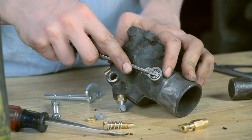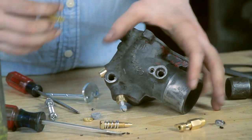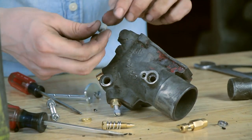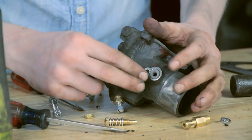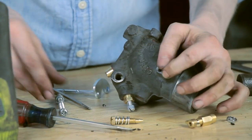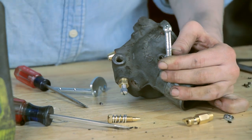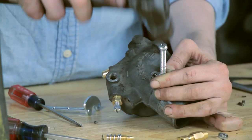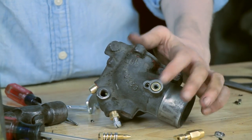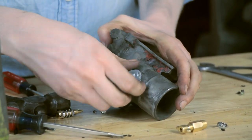I'm prying the rest of this packing out down here at the bottom around the throttle shaft — there it goes. I'm going to use a pick to make sure I've got everything out, and it looks clean. There's a new felt packing — I cut mine in half because in the kit it comes too tall. Then I have this piece that goes over top, and I'm going to gently tap it into place using the same driver I used up top at the throttle shaft. I'm going to make sure that my shaft goes in there — yes, I like that.